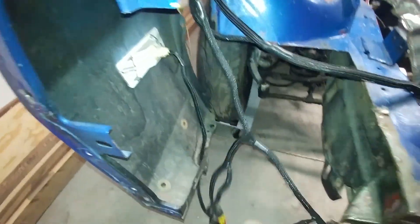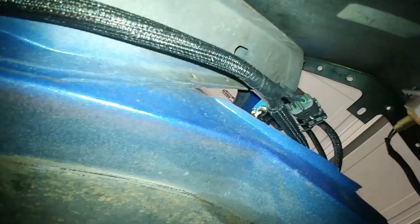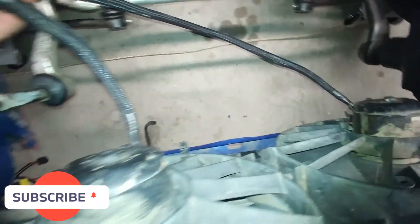Just showing how much this harness is cleaned up with the nose on the car — I really don't think you'll see much of the wiring harness now that this job is done. Switching over to the passenger side for another pan shot — grommet in, some cushion clamps to hold that harness up and away from the tire. It really wasn't a hard job; I would have gotten it done a little bit faster but waiting for parts and I had surgery — I'm all better now. I got a couple more things to do before I get the motor back in. Stay tuned, we'll get the car back up and running real soon.